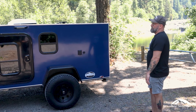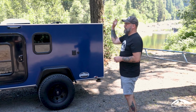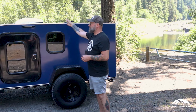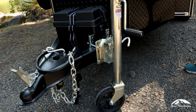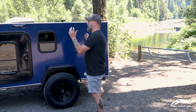All of our Burnsides come standard with a 3,500-pound Timbren suspension. This trailer weighs under 1,500 pounds as it sits, so that's a lot of capacity to throw gear on and pack inside. You're still going to have that great smooth ride with the Timbren, and there are nice heavy-duty Jeep fenders. At the base of this model, you're getting a lot of great features: a full electrical system, stabilizer jacks, a powered roof vent — whereas most base square drops come with a passive vent.